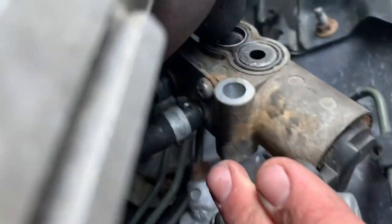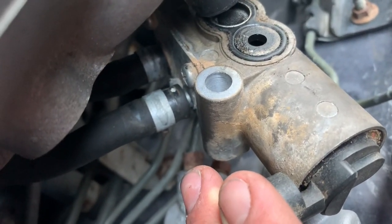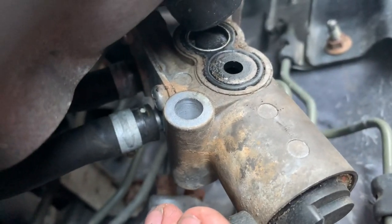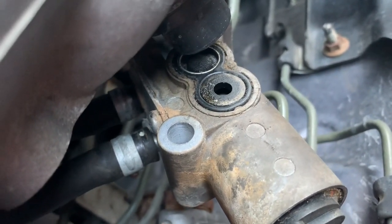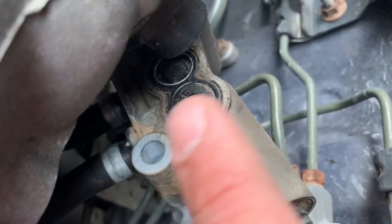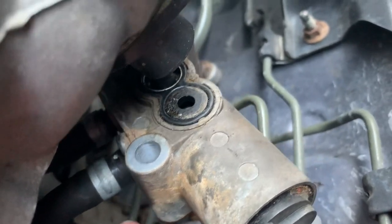And also, I was peeking down here, and the little vacuum line right there on that right side, the clamp's not even on it, and it looks like it could slide up just a hair more. So I'm gonna grab some carb cleaner and a Q-tip, clean this up as much as I can, pull that clamp on up along with the hose, make sure it's sealed.